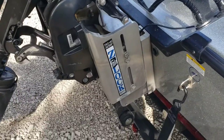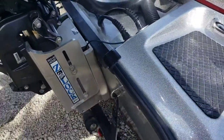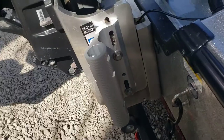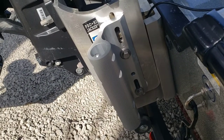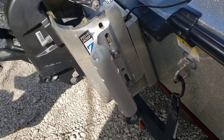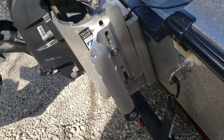We're going to get to releasing the motor mount. On my motor mount, I have three bolts on each side. We're going to unscrew one screw at a time and then mount this bracket right there. The first part of the mounting bracket for the jack plate is mounted on. It only came with two screws, so I'm going to buy an additional screw for the other spot of the jack plate — my old jack plate had it, so I'll put a third one in there for safety.